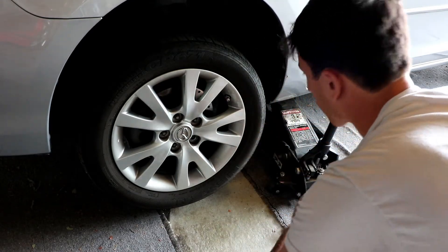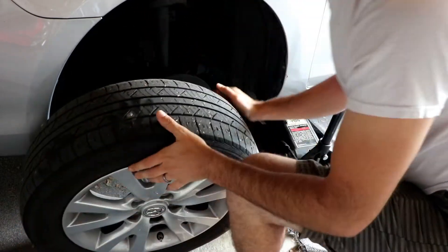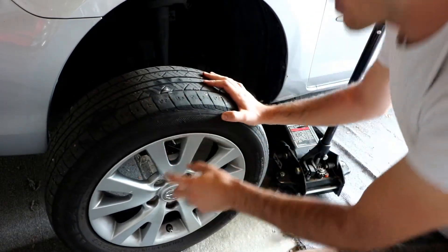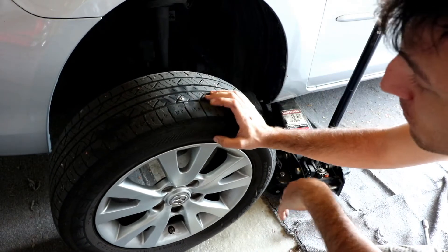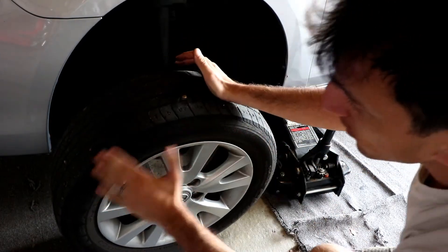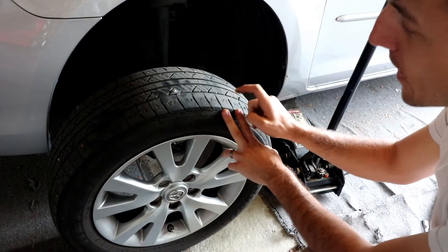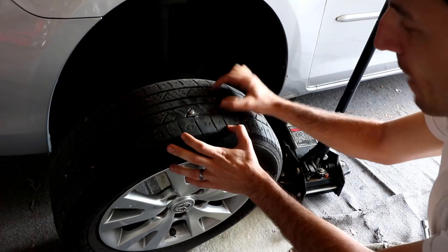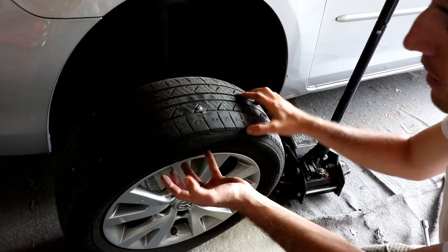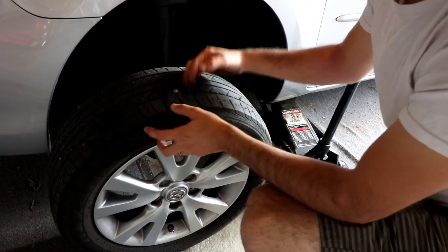We got all the lug nuts off and the tire is out. I can see the spot where the puncture is. This particular vehicle has either bad alignment or the tire has been flat for a while. When the tire loses air, it compresses down and you get a lot more wear closer to the sides of the tire. So this tire isn't going to get all of its life out of it because the side parts will wear out before the center, and you won't maximize the mileage on this tire. That's why it's important to find a leak, fix it, and make sure your tires are properly pumped at all times.